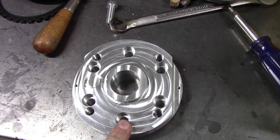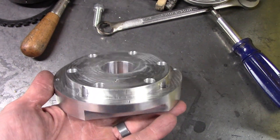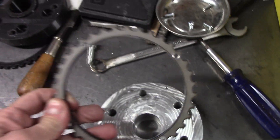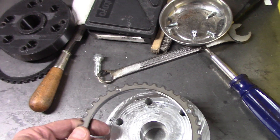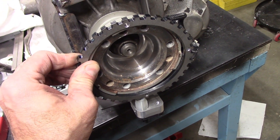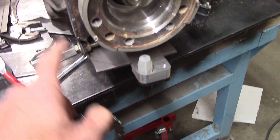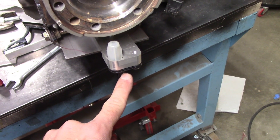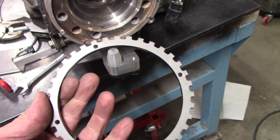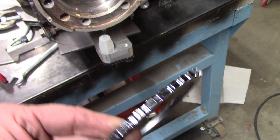I'll insert some shots of this being made, but basically this is an aluminum adapter that I whipped up on the mill. It also accepts a trigger wheel, which I had laser cut at SendCutSend — my first time using those guys. That bolts to the back with four screws, and the ID is the right fit to the OD of the flange to keep everything concentric. I put a little aluminum wing on the shifter base incorporating the stock 2017 vehicle speed sensor. The trigger wheel is 36 teeth, the same as a stock MT82 2017 Mustang, so it shouldn't confuse the computer too badly.